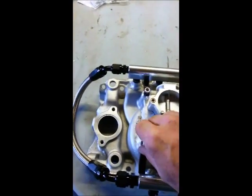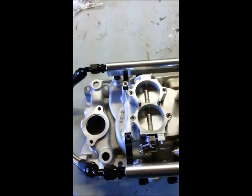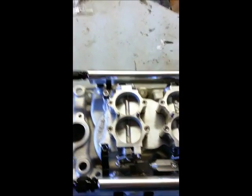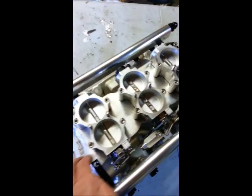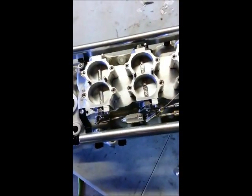I pull the bolts out separately. Notice they're different lengths, and there's also different length spacers underneath the fuel rail mounts. That's because the manifold is at a slant. Let's pull that spacer right out. On top, due to the carburetors needing flat float bowls, so the fuel is at an even level as compared to the car. Then you just pull the fuel rail straight up.